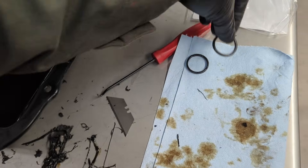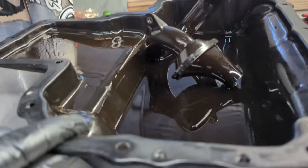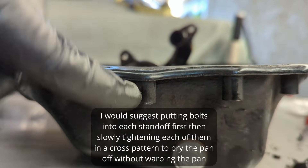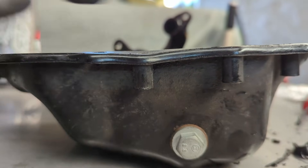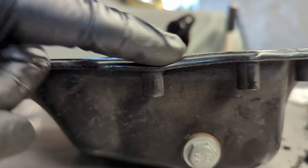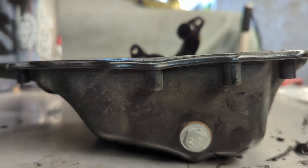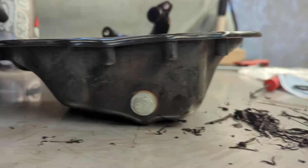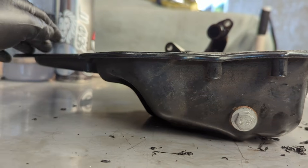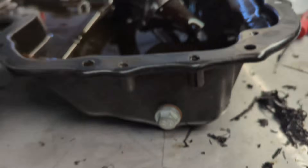On top of scraping old gasket material being such a tough job, the pan was stuck on the block so badly that when I threaded the bolts in to pop it off, it actually warped the pan. Here's the little stud — you thread the longer bolt so it pushes against the block and pops the pan off, but the RTV was on there so good that it warped the pan right here. It doesn't look like it affected the inner lip, which is probably the most important part. If you're going to take on this job, I'd suggest being ready with a brand new pan so you don't run into this issue. I'm going to run it just because I don't have another pan right now — if it leaks, I'll order a new pan.